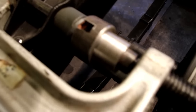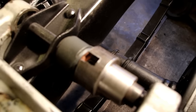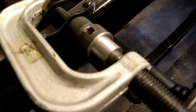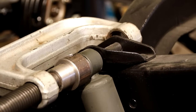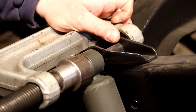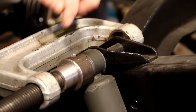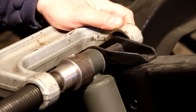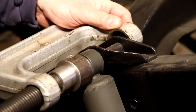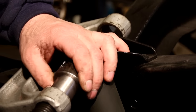The lighting isn't great but as we turn this here it's going to squeeze that washer and the shock bushing back, and then we can get a cotter pin in there. What we need to do is compress that — we'll just take our wrench and compress it enough so that the washer is beyond the hole, then take our cotter pin and slip it in there and let the pressure off. Shocks can be kind of a pain.